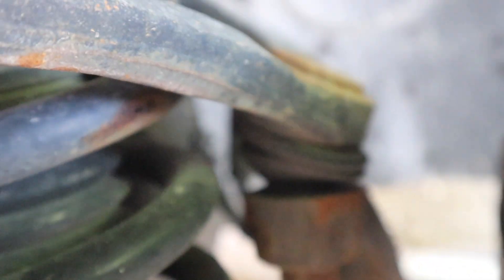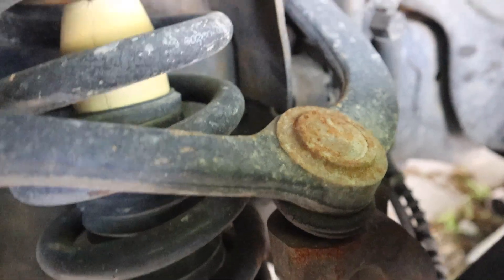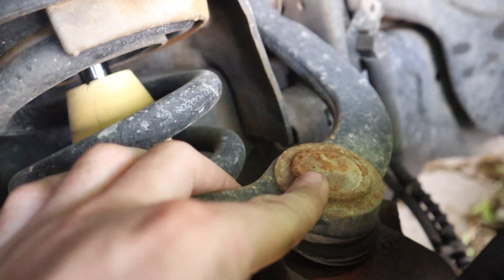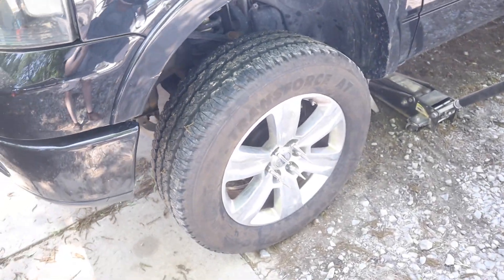This is the factory angle on the ball joints with the Detroit Axles. As you can tell, that's a lot of angle on a regular ball joint, and these are non-serviceable - you can't grease them. The KSPs are serviceable, they do have grease zerks. So we're kind of getting a better deal all the way around.